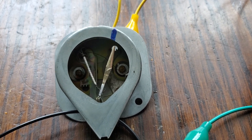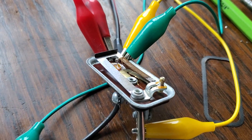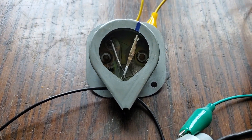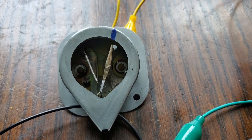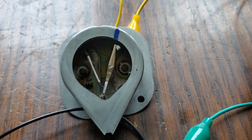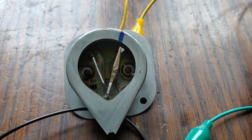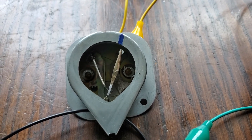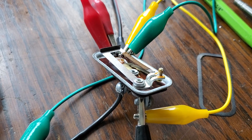As you can see here, our gauge is still more or less right on the money. This stuff is analog technology — both of these things — so it's never going to be exactly perfect. But clearly we are getting a 5 volt average output, which we know because that's exactly where our gauge read at an actual constant 5 volt input. Now we know our regulator is working properly and it's good to install back into the vehicle.